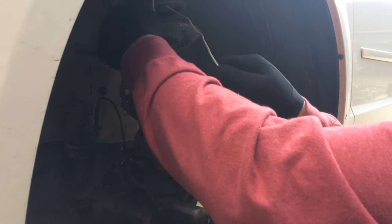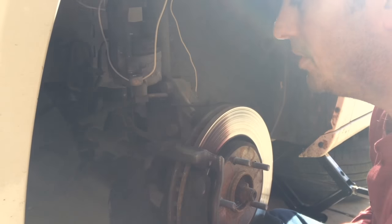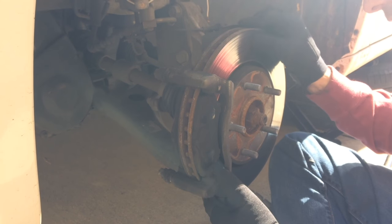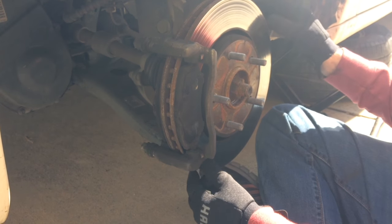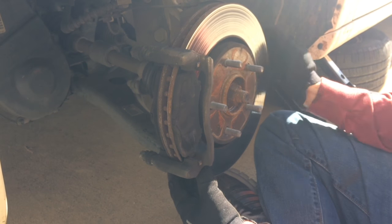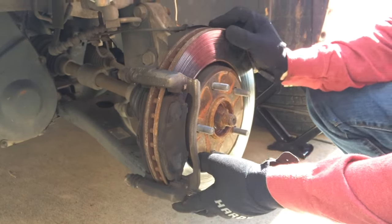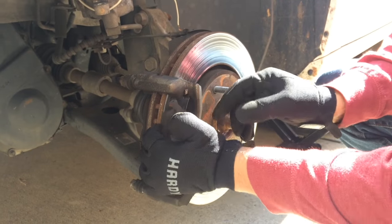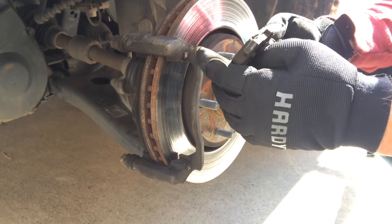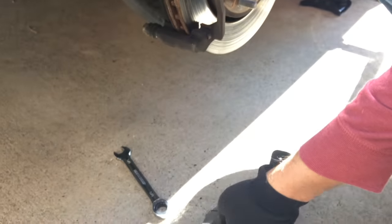You just don't want it to fall because the brake line could break. This can get to be a dirty job — brake dust all over you — so I'm using gloves. If you were to replace the rotors, you'd have to take off a couple more bolts back here to pull the rotor off, but these rotors look okay. Some rotors you can have turned, which is usually a little less expensive. Rotors are about $35 a piece mid-range.